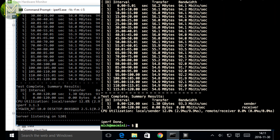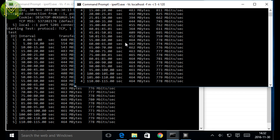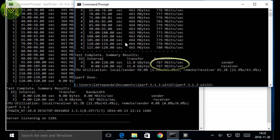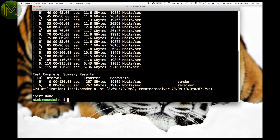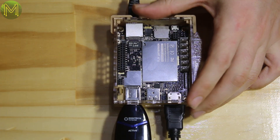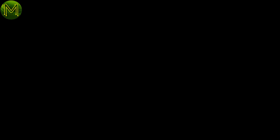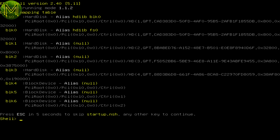Moving on to Ethernet performance: I saw a decent 93Mbps under TCP, pretty close to 100Mbps, and not many boards with this chip can do this. Next I tested the local loopback network — interestingly this was pretty slow, coming in at under 800Mbps. I would have expected much better than that; to put it in perspective, my Mac Mini can reach almost 20Gbps, and most modern PCs should be hitting that mark. One of my Raspberry Pi 2s was hitting 1.7Gbps. Next I wanted to see if I could boot from SD, so I installed Debian Linux onto the SD card. The install went through without issue; however, the BIOS didn't even scan the SD card slot for a UEFI boot loader, so you're stuck with using USB and eMMC boot for now, until they update the BIOS.